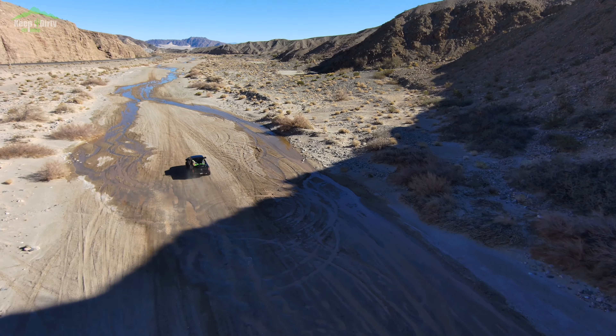At first I figured my battery was going out. We tested that — it ended up being fine, but we did have to figure out what was staying on and killing the battery. We couldn't figure it out for the longest time until Bailey and Hannah Racing Design noticed that our water pump was always on. This right here is the water pump for the supercharger.